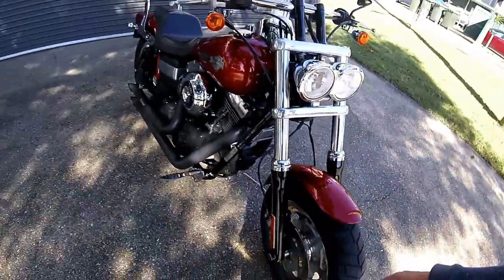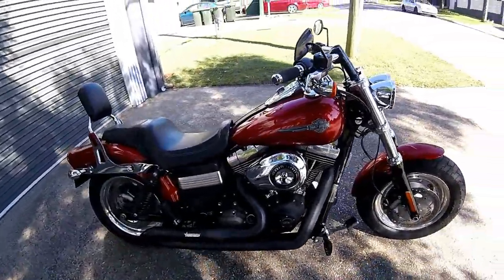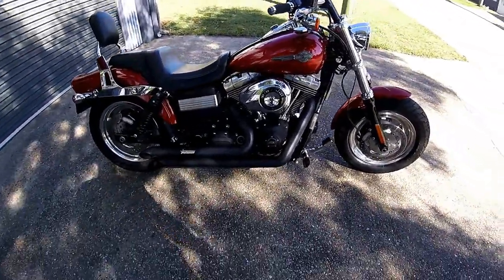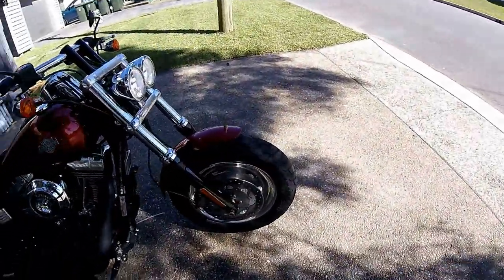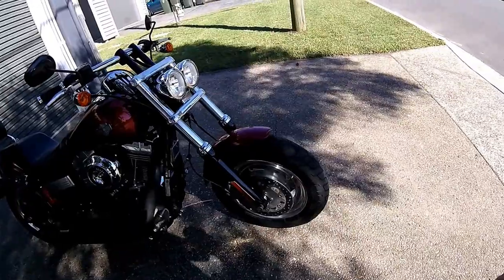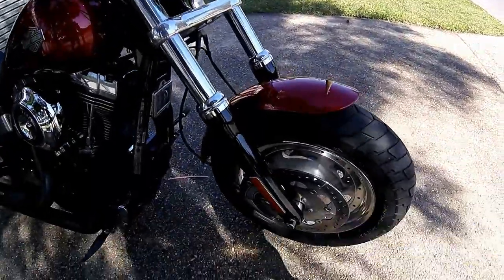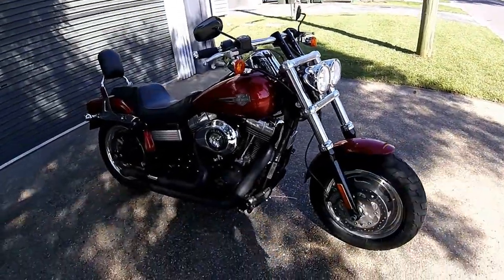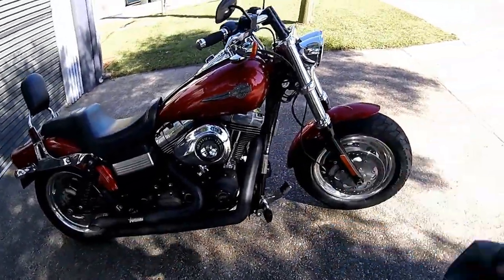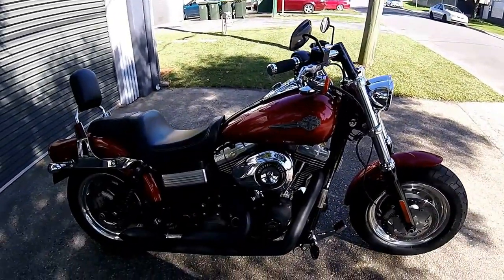Alright. If it's been raining and you're riding your bike, this is an all-weather bike. My other Harley was an all-weather bike. You may need to ride it the next day, or just run it around the block, just to make sure that any rain that you've got hasn't set into the wheel bearings. But when you use degreaser and you use the car soap suds, they clean your bike. They're a degreaser. They take the oil out. You end up with wheel bearing issues.